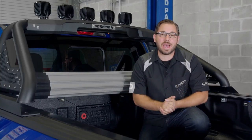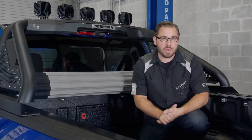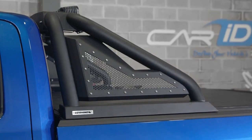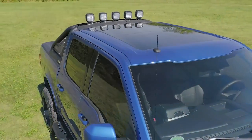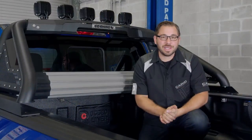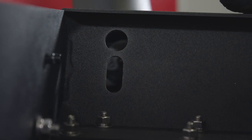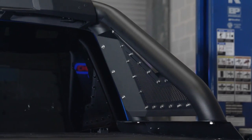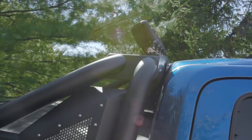When it comes to the physical installation of this sport bar, it's really not bad and it can be done in an afternoon in your own garage. I do want to prepare all of you though — it will require drilling into your truck bed to get this mounted, so if you're a little hesitant to take on that task, just take it to a professional. Start by assembling the entire sport bar off the truck — this includes both inner tubes to the light bar mount, bolting the base mount to the tubes, and installing the side covers. Once the sport bar is all together, lay it onto the bed rails to mark your holes, drill, install the rivet nuts into your newly drilled holes, and then just bolt the sport bar to the bed. After that, get your lights mounted and wired, and you're ready to night ride through the woods.